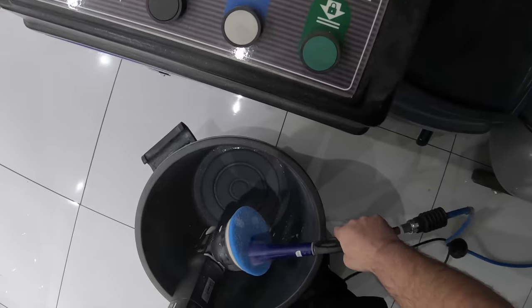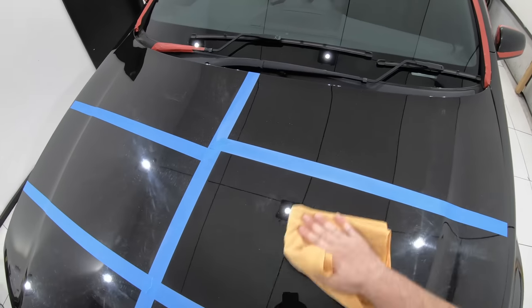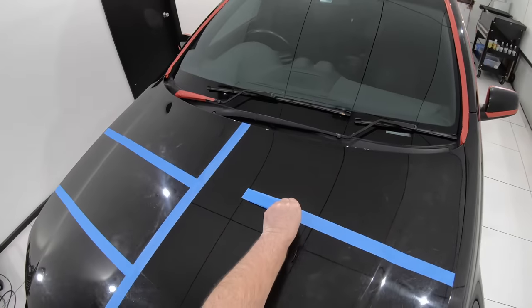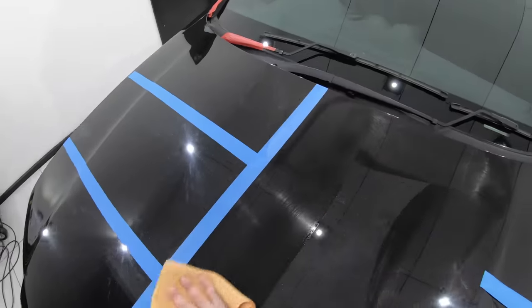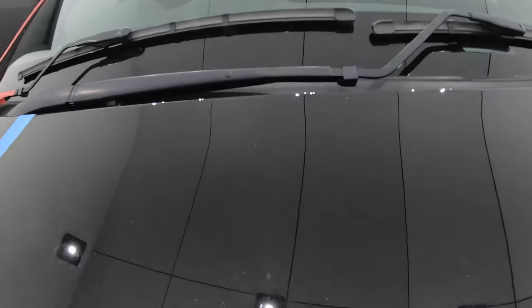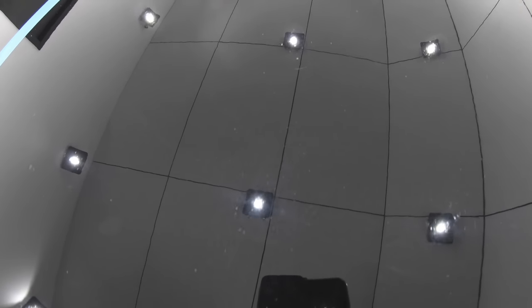You can even go in the complete opposite direction and just do 2 row passes and halve the speed of your arm to a super slow arm movement to once again obtain very similar results. Why? Because you're still polishing for the exact amount of time, with the same machine speed, same amount of pressure, and within the same size section. All you're changing is the amount of passes you do, but compensating for that by adjusting your arm speed. So then, why do 4 passes instead of 8 or 2?